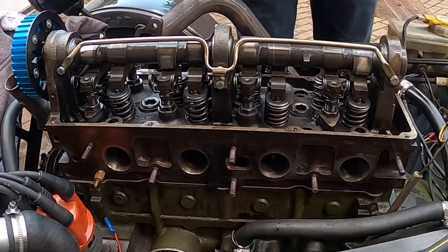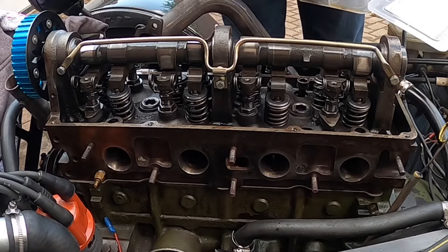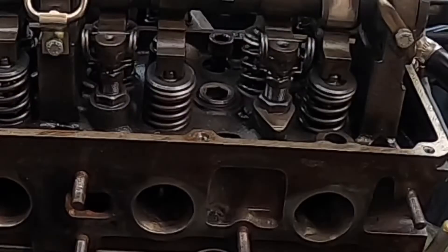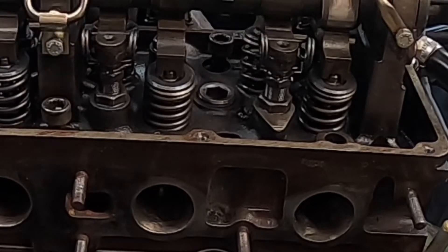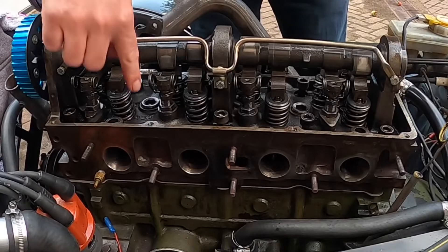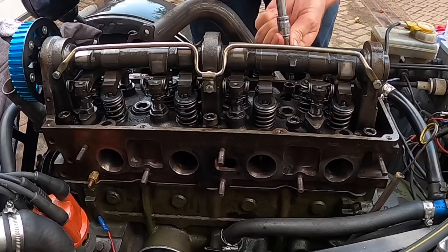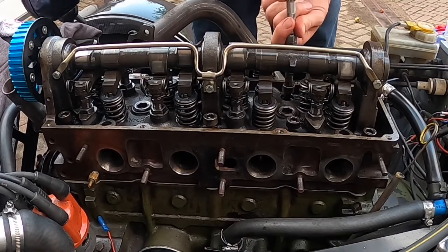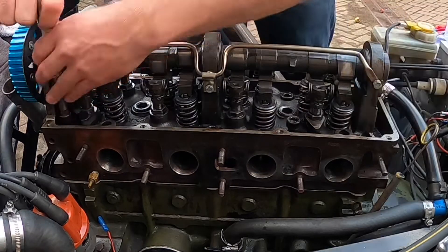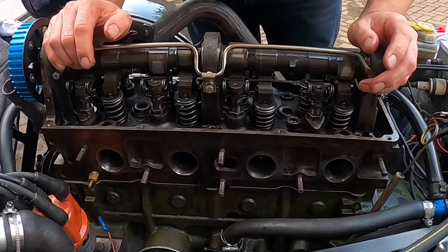I shall now put all the other bolts in place, slotting them down into the holes. Bolt them down and then I can remove the two orientating bolts. All I'm doing is making sure the head does not move — lightly bolted down, that head can no longer move on that gasket.